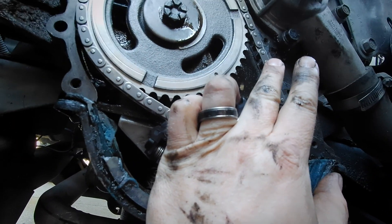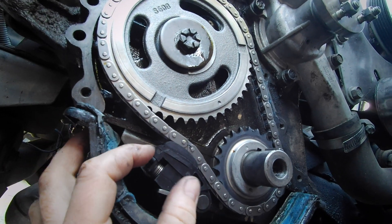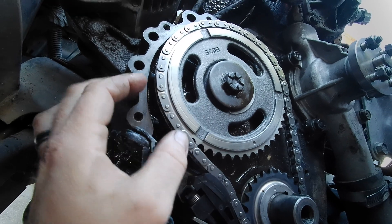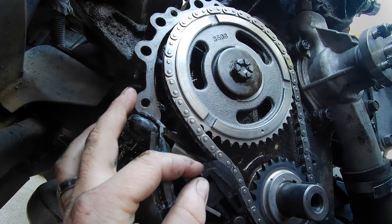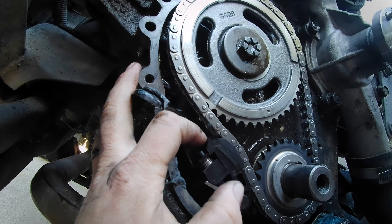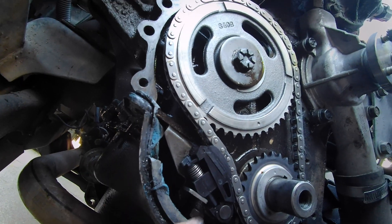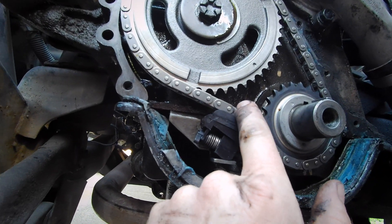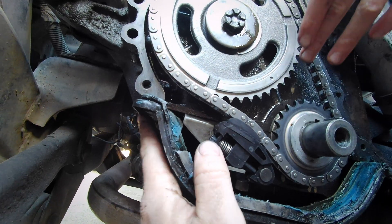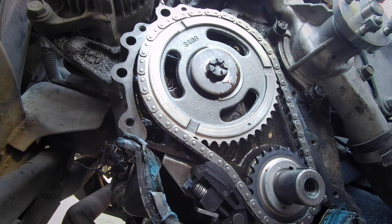On the cover we've got that piece that goes back on to hold the chain tight on this side. We tighten this bolt up here — it's a half-inch bolt, uses a three-quarter socket, take it off with the impact gun. Now I'll release this — you can see it tightened up on the chain, snugged it up real tight. Now we just have to put the gasket on, seal it, and put the cover on.